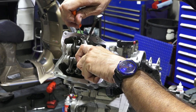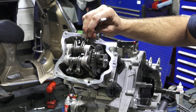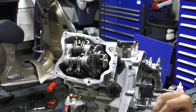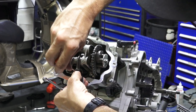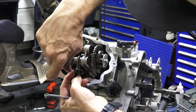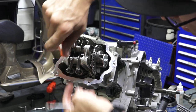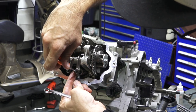So I wanna, there we go. Now it's good. It just drags ever so slightly, and that's what you want. And you can just hear it snap a little bit. Don't forget, a loose valve is a happy valve. These ones are very, very loose because it's a brand new rocker. And what I tend to want to do when they're brand new is get them both approximate to the right adjustment. So there we go.